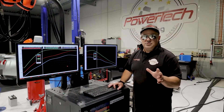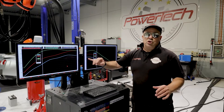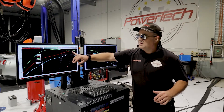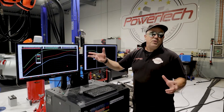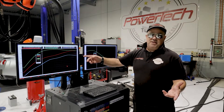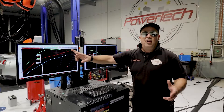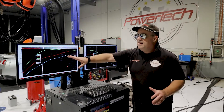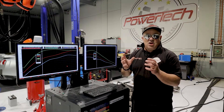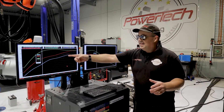This makes an interesting comparison. The light blue line you can see here was the standard tune — made 315 kilowatts at all four wheels. The red line, a little bit better, is the off-the-shelf or canned tune that was in the car, making 340-odd kilowatts. The custom tune — fat, fat, fat. Lots of bloat in that power and torque curve because we can feed it in and custom write the software to suit the car. That's what you get with a canned tune versus a custom tune.